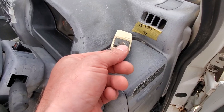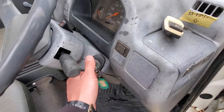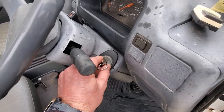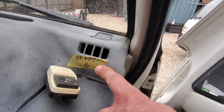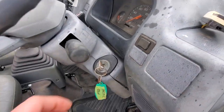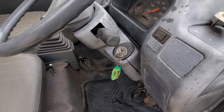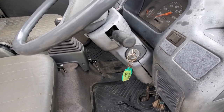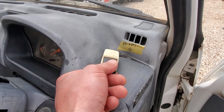The coolest part on this is the push-button start. The key turns it off but this will actually turn it over - it won't start unless the key is in the start position. I was at the port and I didn't know what this was. This probably says in Japanese 'start here.' I ended up getting somebody to tow me and we push-started it - popped the clutch and it started up no problem. But this is the way you actually do it. The battery is just no good.